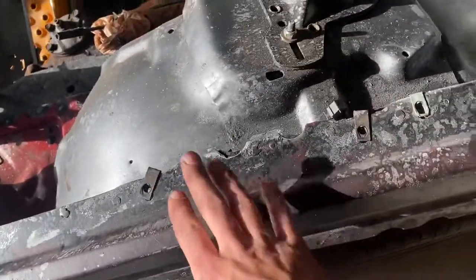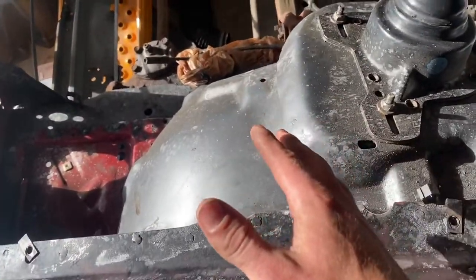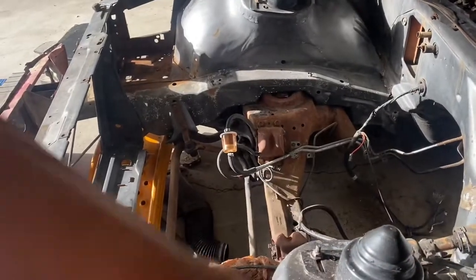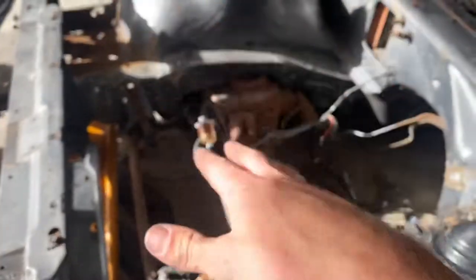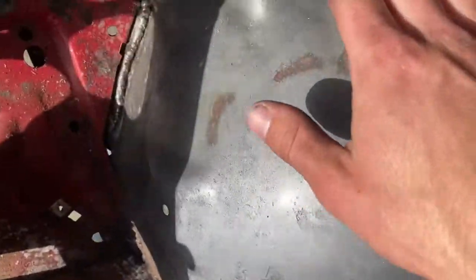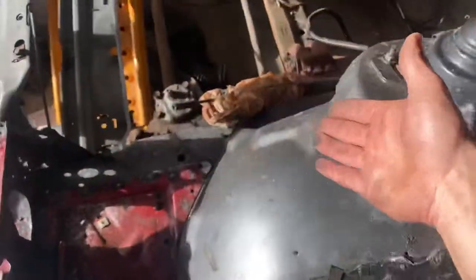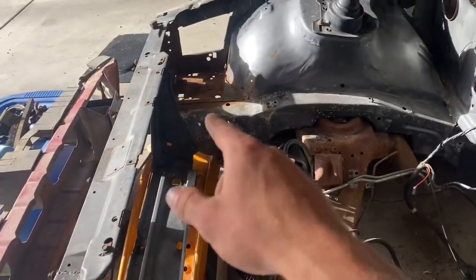I've been working on prepping for paint, and even after scuffing everything up the paint stripper still isn't working, so I'm just going to save it for a future project. What I'm going to do is get everything cleaned and roughened up as best I can. I've got some rust-reforming primer that converts rust, some regular matte black paint, and also some undercoating for under the frame rails and the transmission tunnel. The dirty areas have been cleaned and etched, so the paint should stick pretty well.